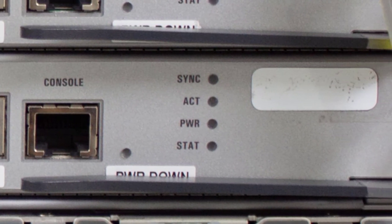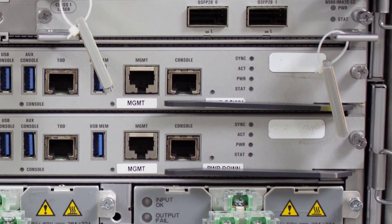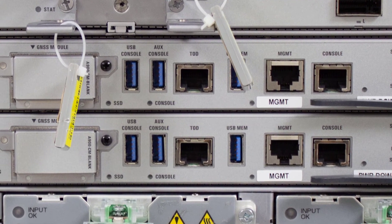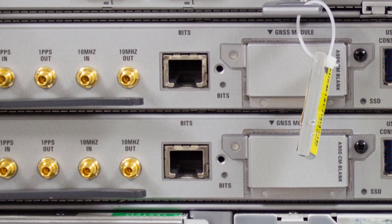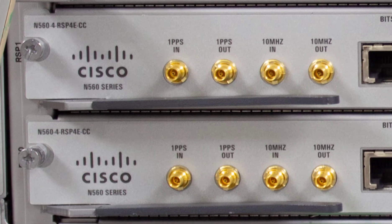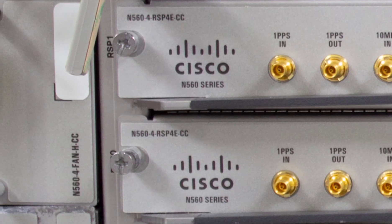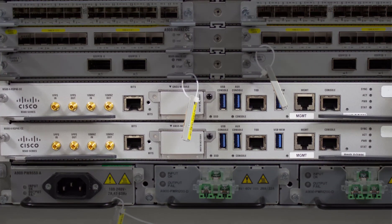You can spot it from the CLI by running a show inventory, which will give you the serial ID with or without an E depending on the type of RSP4 card you have. We have two RSP4 slots and two RSP4 cards, which means we have RSP redundancy on this system. In the access and aggregation space, high availability is super important, and having two RSP4s in a 1-to-1 or hot standby redundancy really helps. Hot standby means the standby RSP picks up all traffic and routing and switching processing without missing a single packet if the active RSP fails.